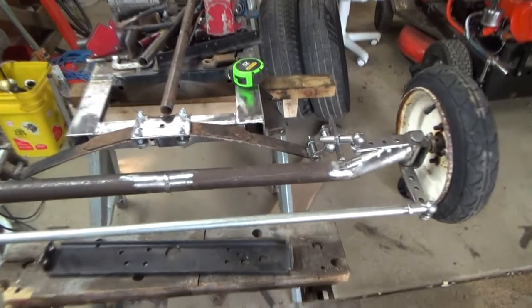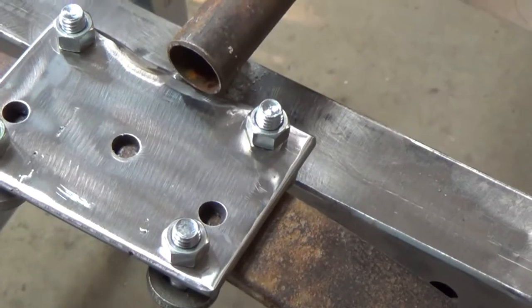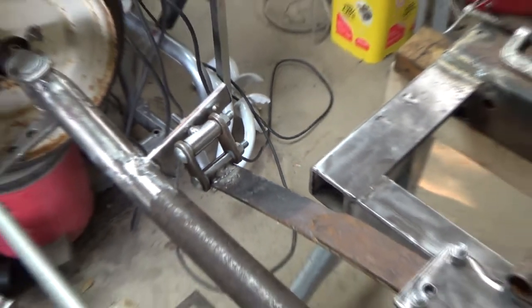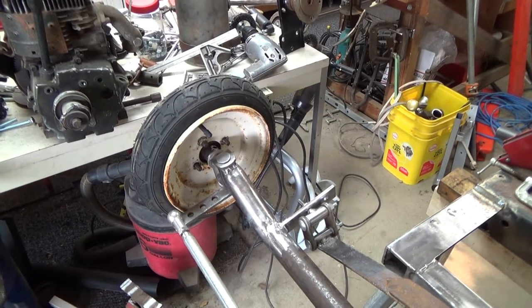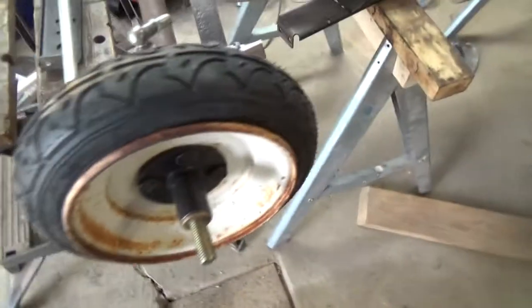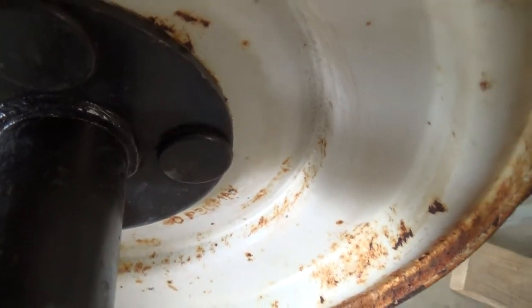And just in case you guys are wondering, all of these nuts will eventually be lock nuts. There and down on our perches as well. I mean our shackles as well. And I think I figured out, rather than having to cut my hub that I spoke about, I think I can drive those studs out and turn them around so that they're facing the other direction, which would make it very nice. I really don't want to have less hub. Yeah, so I think they're just press fit in there. What do you think? I think I can drive them out, turn them around, put them back in.